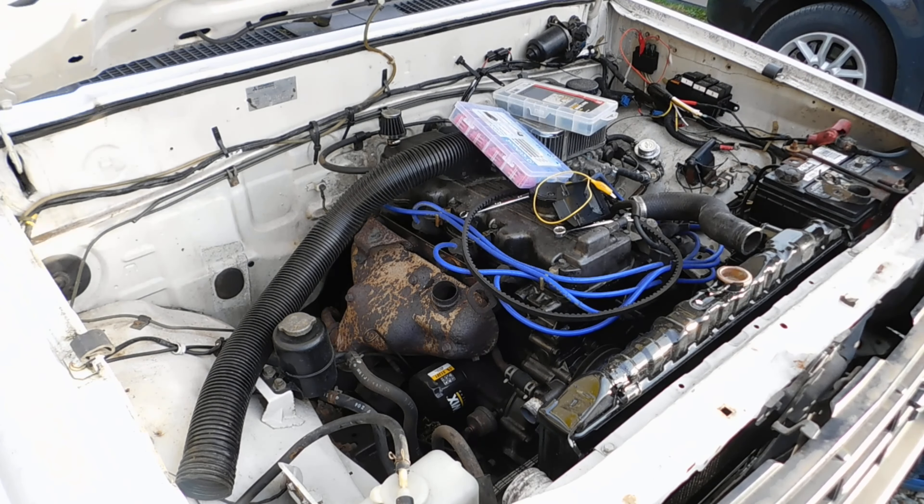I'm tired of having cars with puddles in them. Well, Performance Radiator — it's a very nice looking radiator. The tank itself is the same size, but the brackets don't necessarily match. This bottom bolt does not fit the bolt hole, so let's see if I can get this to adjust and get the threads to line up. There we go — bolts are lined up.